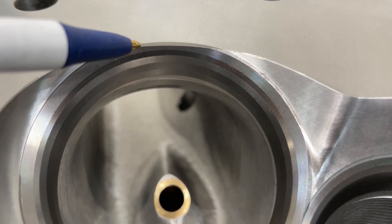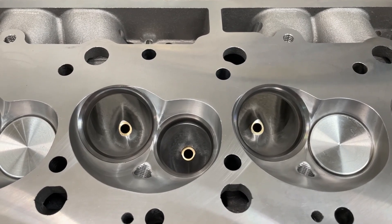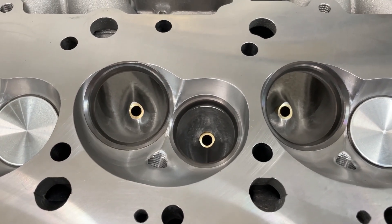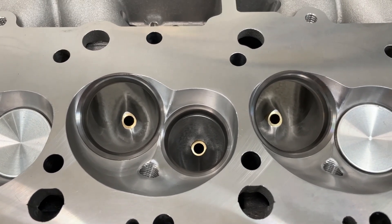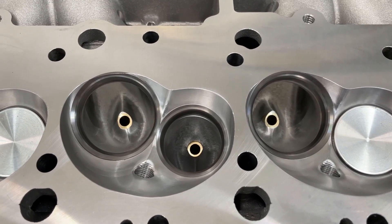I've seen this happen from different manufacturers and from people who brought in heads to be ported — someone milled the crap out of them trying to get the compression ratio up, not thinking that yes, you gain compression ratio, but because of the loss of flow you're actually making less power. Typically when I do this type of work, I'll take the valve job and sink it in so that I've got a lot of top cut, then mill, so it's all the way out. You can see it's got a pretty good amount of top cut — about 60 thousandths at its thinnest point — and it's much wider in other sections, which is critical for flow. AFR on their website advises that if you have any milling done, it will affect airflow, and that is true because it removes the top cut.